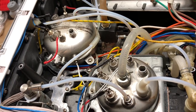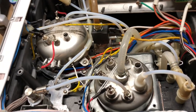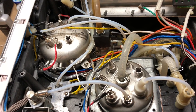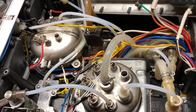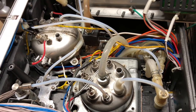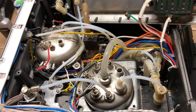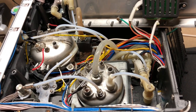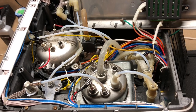Hopefully that helps if you're having to get into this machine to this extent and you're trying to figure out what parts go where or what replacement parts you need. It's really worth noting that the common orange gasket does work really nicely in those two locations and will hold the pressure — I ran many, many shots through it, including testing the pump at very high pressure, almost full pressure, and it didn't have an issue.